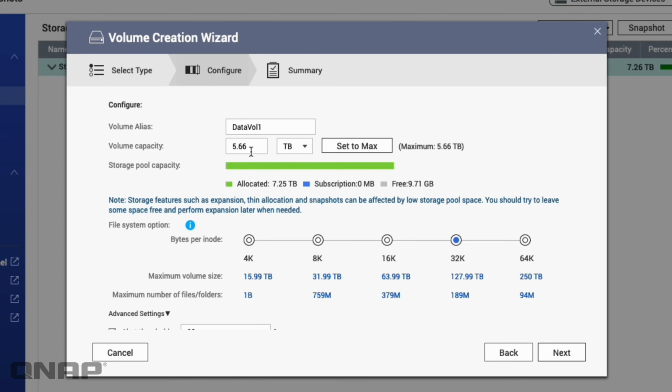When we get to the SSD cache later, the SSD cache is enabled on volumes specifically. So if you wanted one of your bits of storage to be accelerated by the SSD cache but not another, it might be wise there to create the 2 separate volumes, because you can add one volume to the cache and leave one out of it if you wanted to. I'm fine with all the data on this NAS being accelerated by the SSD cache, so when I go to create that, I'm fine that it will only see one volume.